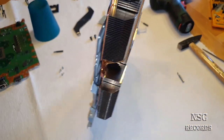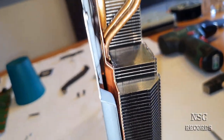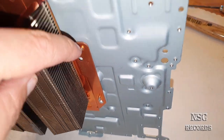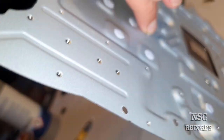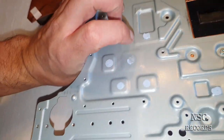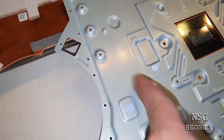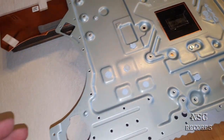Let's just turn it to the back, and you can see here when I'm just pressing it down, see that? You see that this side gets there without problem. Here we have also, let's say, a thread for a screw, but this may disturb the motherboard, because the screw is just sitting over there and the motherboard could get contact with the screw, and I just don't like it. But here you can see the screw will sit very much down. That means it's not gonna sit on the top, just like here, and so the screws will not damage anything.